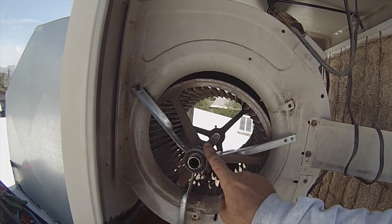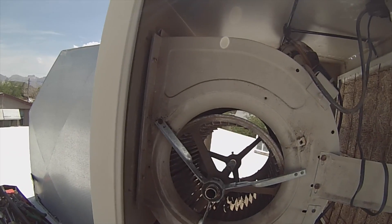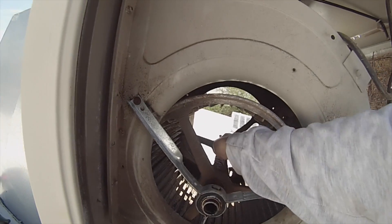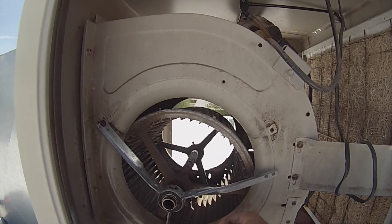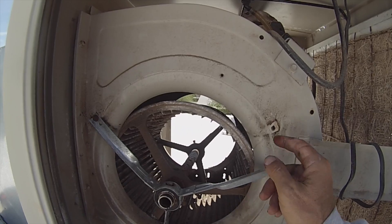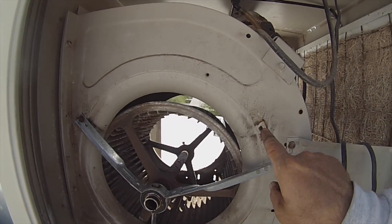I just put the new bearing on there with this little holder in it. I attach this one screw. The squirrel cage is off, so I've got to kind of lift it up. I've got to hold my camera in one hand. I'm going to lift up the squirrel cage — it's not connected yet, the other bearing is not on the other side — but these things line up with this screw hole. I'll turn the camera off, pick up the squirrel cage, and put these bolts back in.